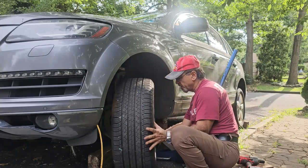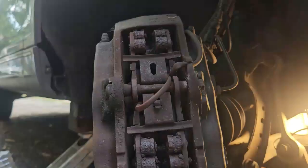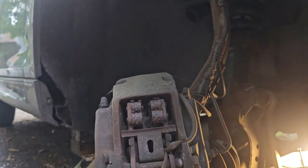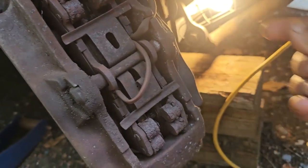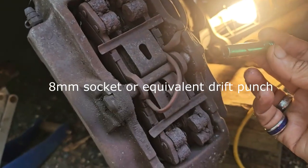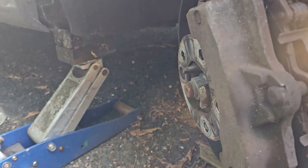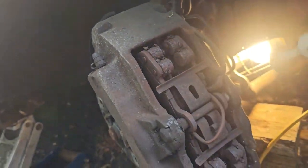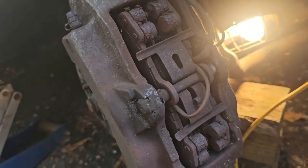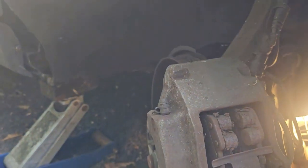On a big truck, you can have a pry bar under the tire, which lifts the tire up a little bit. Same thing on this side as I did on the other side — it's a 13 millimeter bolt that will come out, then I'll knock it out with a socket. Before you do that, you want to wake up the pin by tapping on it a little bit — this breaks the rust.